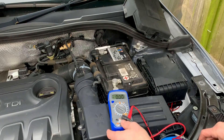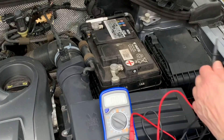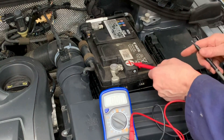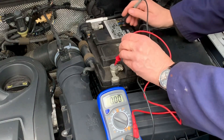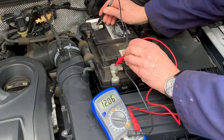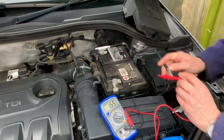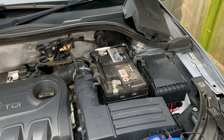I haven't started it this morning, so just going to give it a test and see what's in the battery. Set your multimeter — you need a multimeter for this test — set it to 20 volts and it'll cover the range you need. We've got just over 12 volts there.